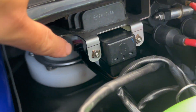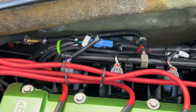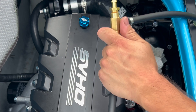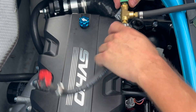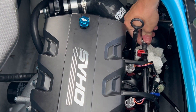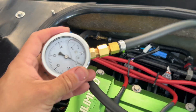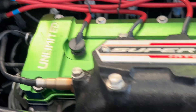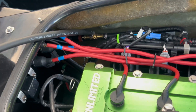You can also attach this directly to the pump if you'd like — it's just easier to shoot the video showing you on here. These quick connects are really easy to attach and you can attach them pretty much anywhere in the fuel system. Here is the Yamaha fuel fitting, and here is the Kawi Performance gauge assembly. The quick connect pops right in, lock it in place. You're not going to reattach that damper — put that to the side. Push the connector on to the fuel rail and lock it in place. This has a lead long enough to make it all the way up to your handlebars, so you can route this and hold it while you're running the ski to verify your fuel pressure.